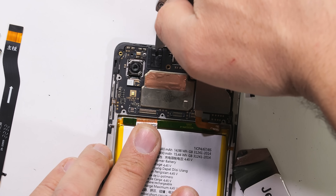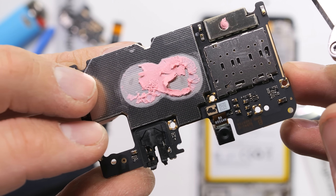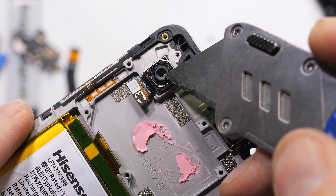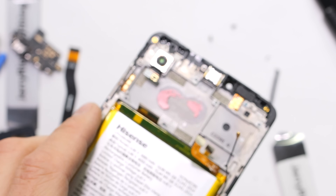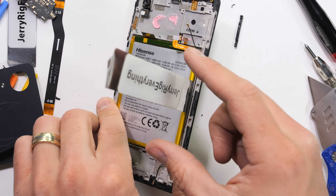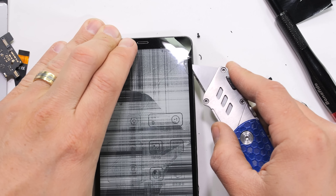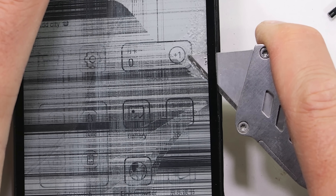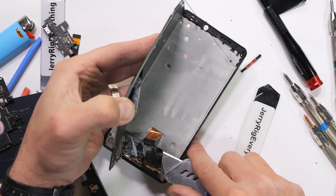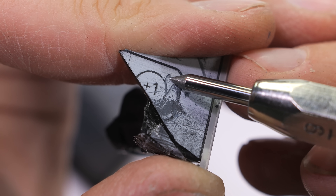There are two more black Phillips head screws holding down the main motherboard, which is using pink thermal paste to transfer heat from the processor to the metal mid frame. The headphone jack is soldered to the board, and the rather small front-facing 5 megapixel selfie camera does not have OIS. The modular 13 megapixel rear-facing camera also does not appear to have any optical image stabilization. Unfortunately, Hisense is using permanent adhesive to secure the battery — a pretty big bummer since it makes recycling all that much more difficult. The most interesting thing is the e-ink display itself: where a normal screen would definitely be off by now, the Hisense A9 is still turned on and readable. Even when the glass shards are brutally ripped from atop the pixels, the e-ink capsules are still unfazed. It's only when I stir the black and white pigments together that the screen finally concedes and is fully vanquished.